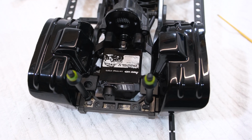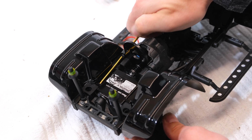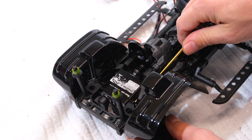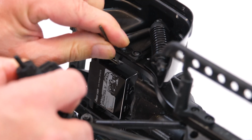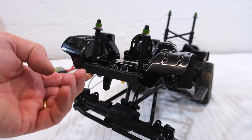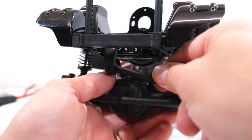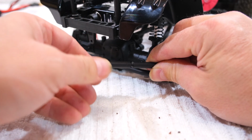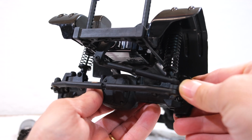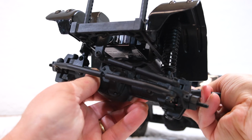Here you can see it. Next I can tighten the screws completely and so finish the installation of the servo. Only the steering rod must be connected to the servo arm. It must be slightly longer, which can be easily achieved by turning the rod ends. Here you can see how it is now after this modification.